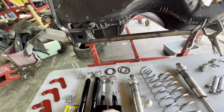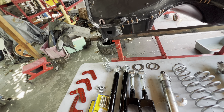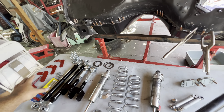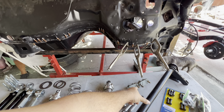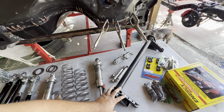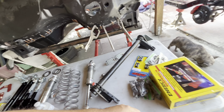All this is a mess. All new hardware for the control arms — when you buy your control arms, make sure you get your hardware new. I just gotta go through all the bolts and nuts, find all the nuts and bolts for all this stuff. I'm still missing one more bolt for that mount. All new washers for that mount too — both of them. And the little thrust bearings, clean those up.